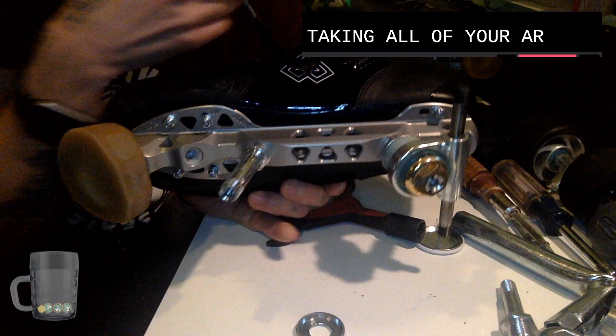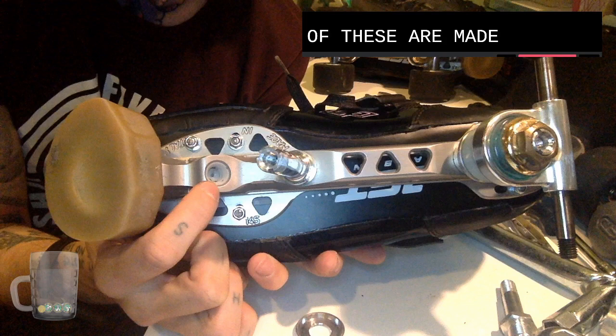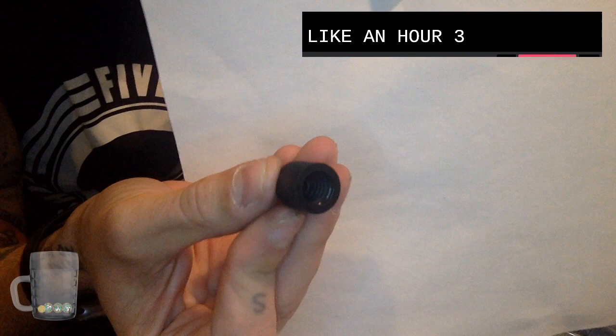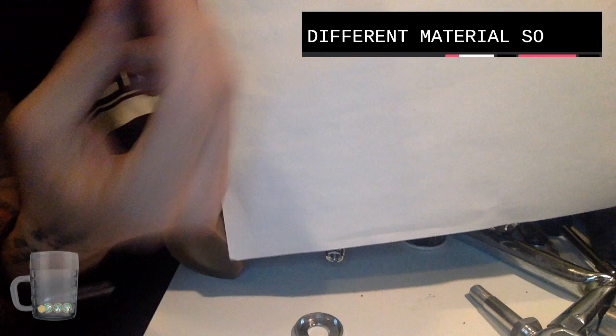What we're looking at here now is this is going to be my pivot cup — this little plastic part. Most of these are made of something called Delrin, which is a very hard plastic. A lot of pivot cups will look like this independently. The Power 9 plates are going to use this type of pivot cup. If you have an R3, you might have something more like a rubber pivot cup — it's a little softer. Whereas with the Delrin ones I cannot squeeze the side — it's a very different material. Different pivot cups for different plates; these are usually very cheap to replace.